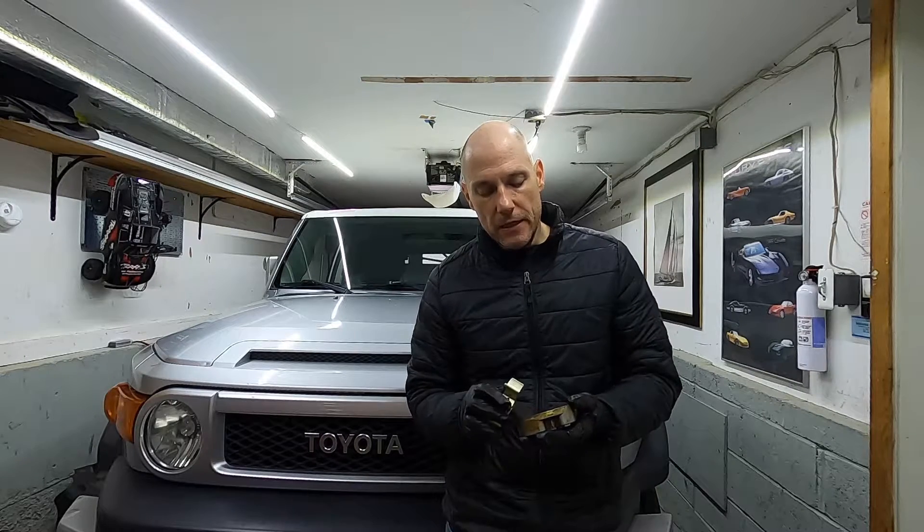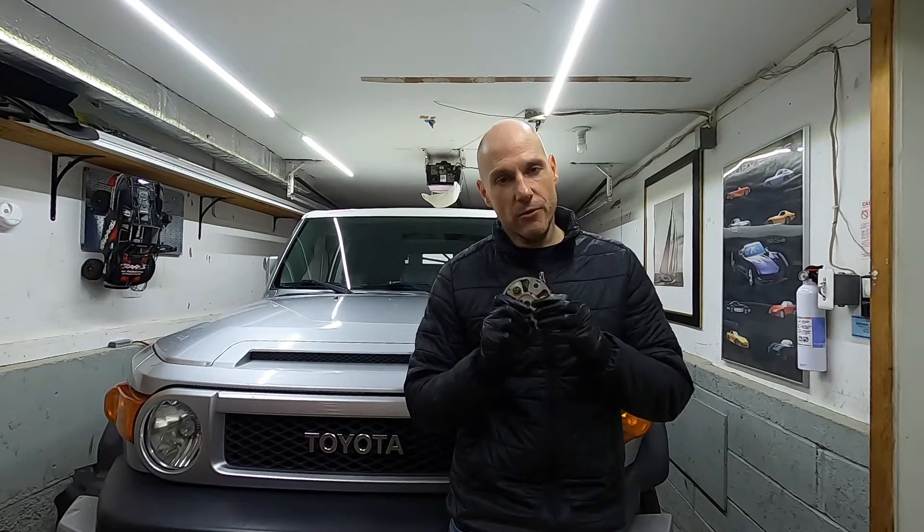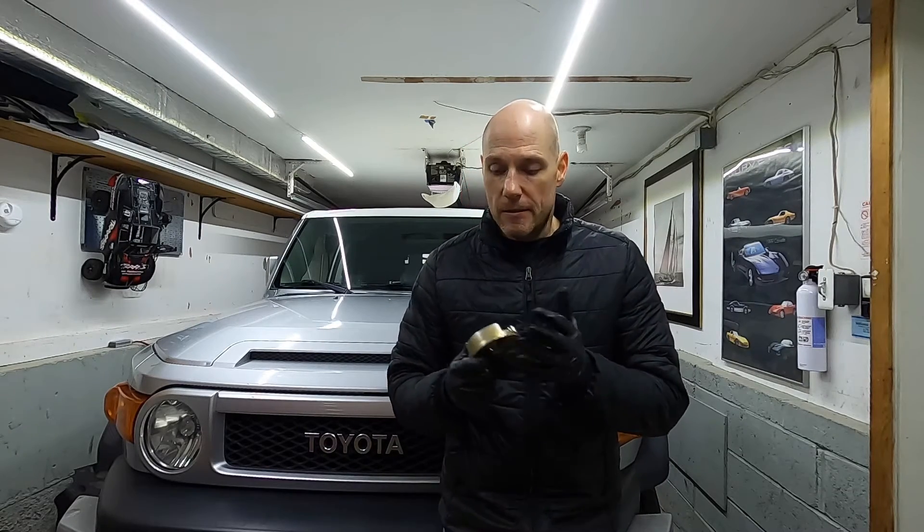He also has a second video where a client dropped off a vehicle with a clatter from the cam phaser — ultimately it was damaged because of low engine oil. Always make sure you have enough engine oil and change it every 5,000 miles or six months. Oil is cheap; these cam phasers are expensive — roughly $350 each, and if your engine has four of them you're talking $1,400, and that's not including labor. Maintain your vehicle and it's going to treat you well. Thank you for watching — hope to see you in the next episode.